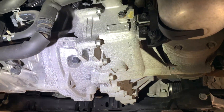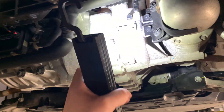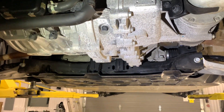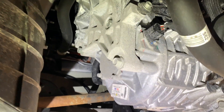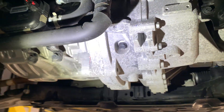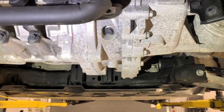It's getting aluminum corrosion on that powder coat — even with the shield, these Canadian winters are just brutal. People say aluminum doesn't rust, but it oxidizes, and in a way it can be worse than steel — look at that, two years old. The oxidization layer is actually very stable though, so as long as it has that layer it's not going to get any worse, as long as it doesn't get disturbed.